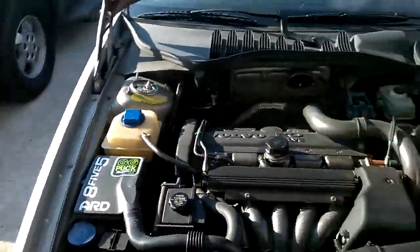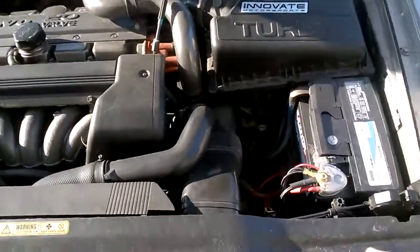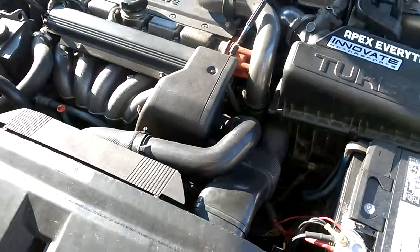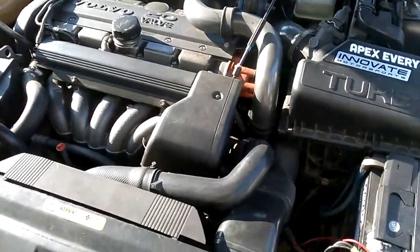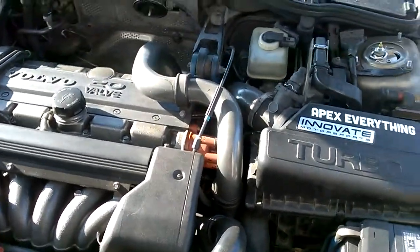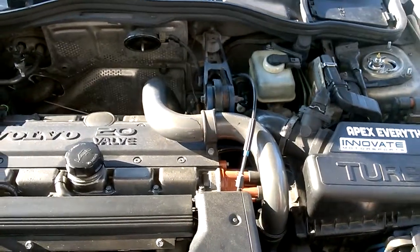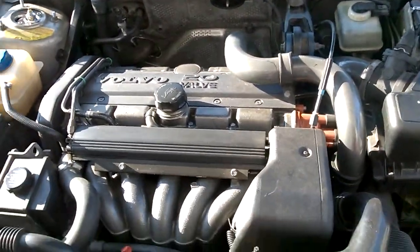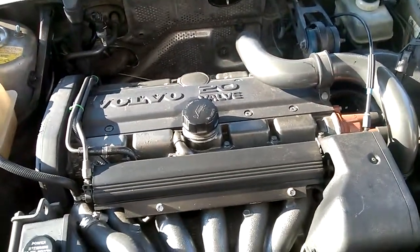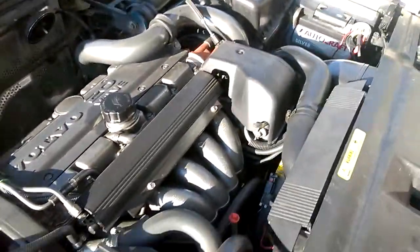The engine compartment is essentially all stock. I rotated the battery 90 degrees — I had planned a ram air setup into the factory airbox but didn't get to it. All vacuum lines are rubber and brand new, all replaced. Brake fluid is fresh. I change the cap and spark plugs every December for all my cars — just regular NGKs, no platinum.